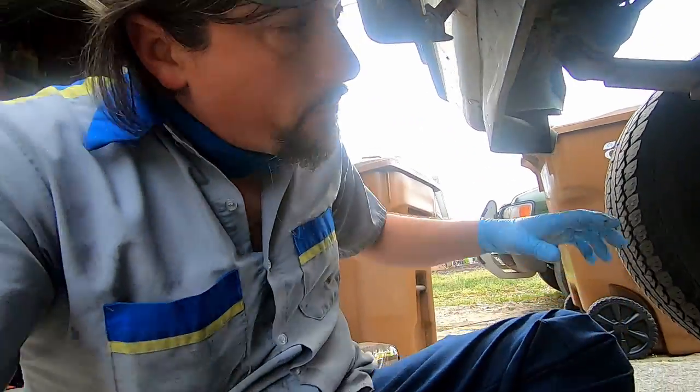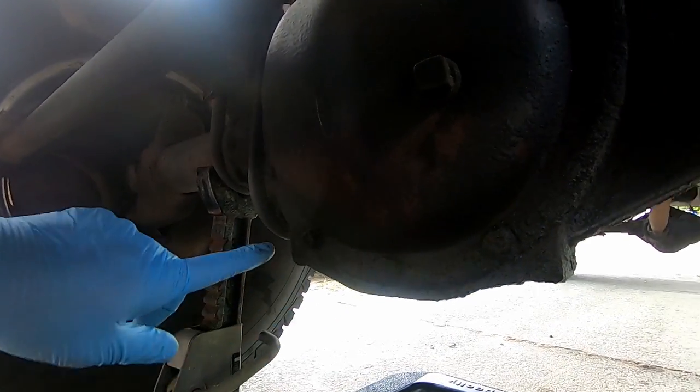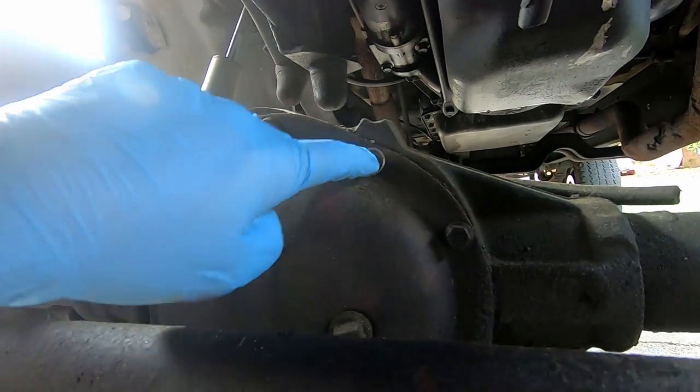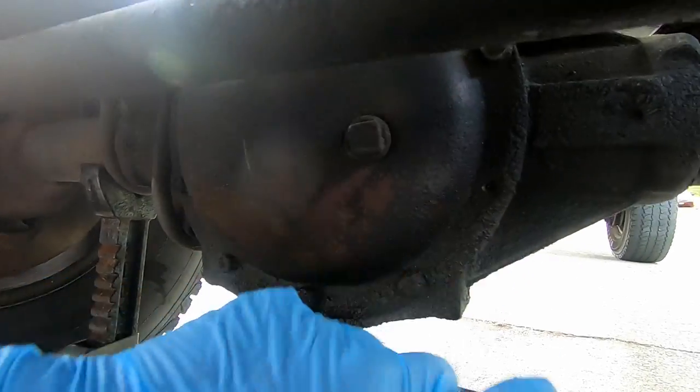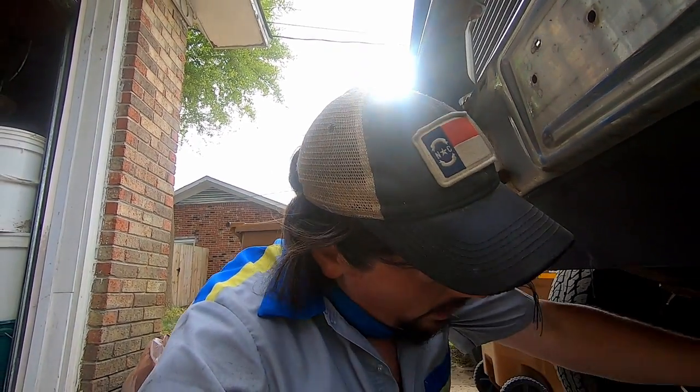Now that we got all that out of the way, let's get to work. I got leaks right here, I got a broken bolt right there - it's broke off in the housing. I took that one out so I can match the bolts up, I'm getting new bolts. But I have leaks, this is all covered in gear oil, and I have to fix it. All I'm gonna do is pull the cover off, clean it all up, reseal it, get that bolt out, put new bolts in. One thing I wanted to show everyone: if you have a differential leak - doesn't matter if it's a front or rear - the number one cause of leaks is the vent. Always got to check the vent.